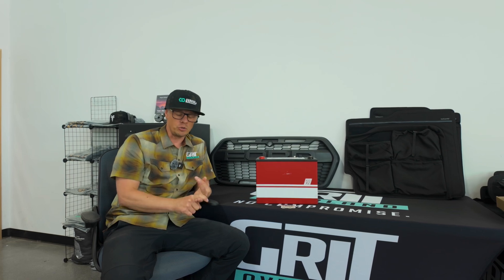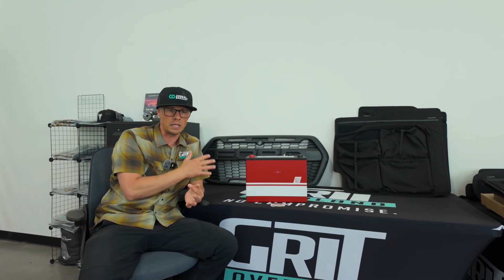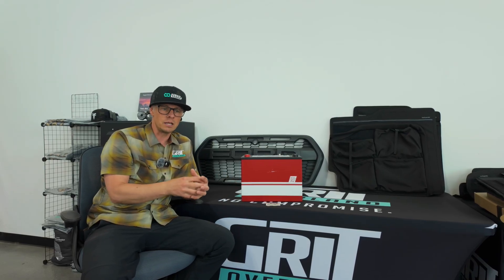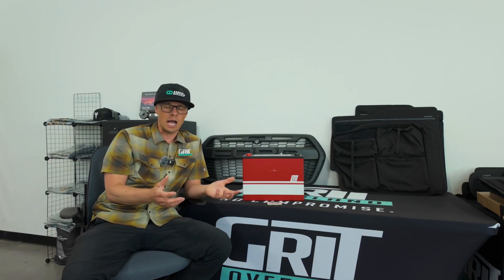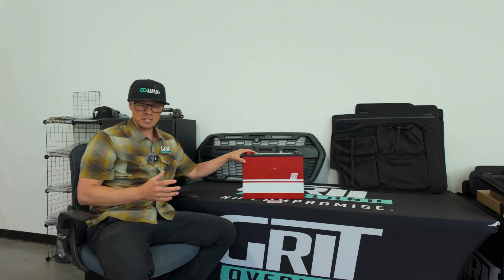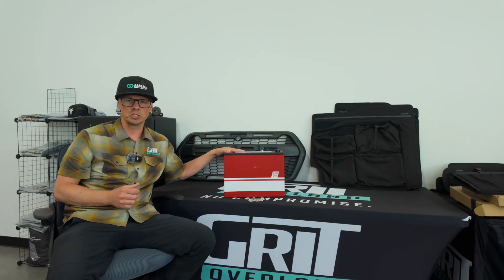You can plug it into shore power. You can turn on the van — which is the easiest — drive it around or just let it idle. That's the beauty of the 12-volt system: you don't have to high-idle it. It can just idle and it will charge at a high rate. And since we're running a gas motor in the Ford Transit, it's not building up in your DPF. Unlike Mercedes Sprinter vans where idling can fill up your diesel particulate filter and cause problems with your DEF system — this doesn't have that problem. You can just sit there and let your gas motor idle and it will recharge this in about 60 to 70 minutes from that 10% state of charge. And it's also charging from solar as well.